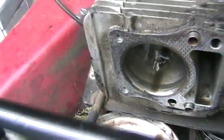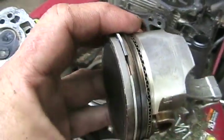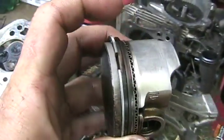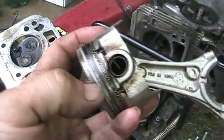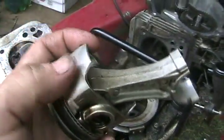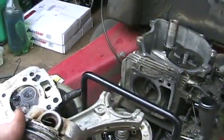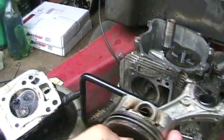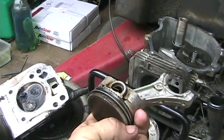But never put it on too tight because the piston still needs to be able to slide out when you put it back in the cylinder. You can even do it with your fingernails sometimes, very carefully, if it's got a big chamfer. Then just tap the back of the piston in with a hammer while squeezing the rings. Make sure you don't have all the ring gaps lined up in line — that loses compression. Stagger them, and don't have them near the pin boss either. Always have them near the skirts of the piston, and try not to have the gaps on the thrust side.